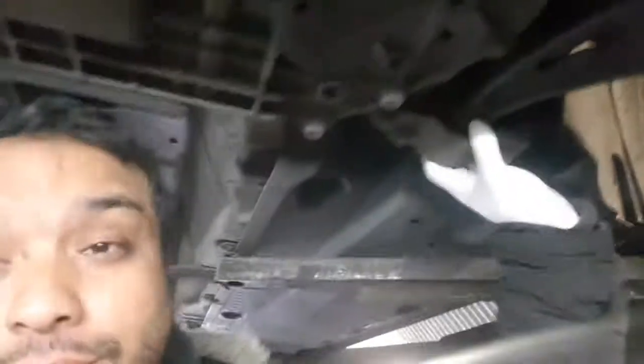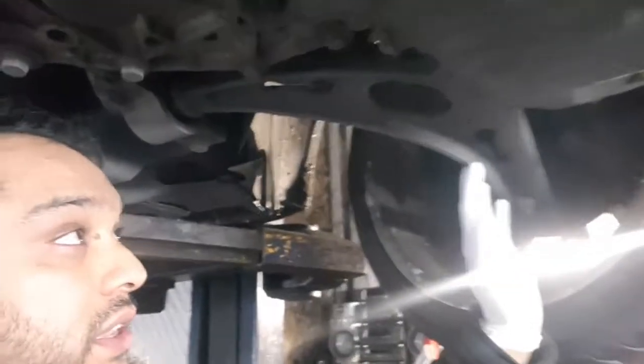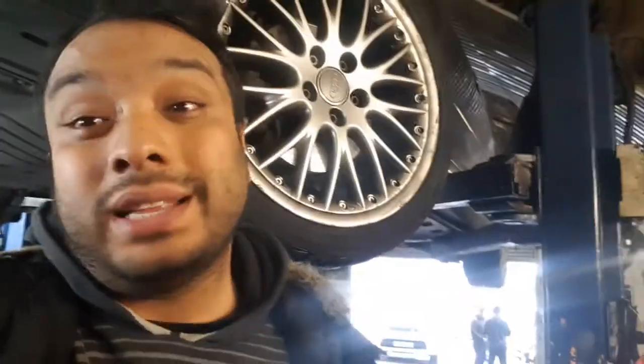So what we're doing is I'm going to change the front wishbone rear bushes — this one here. The thing is, you don't need to go ahead and change the complete wishbone, the complete suspension arm. You don't need to change that, because if you do, sometimes you need to get the wheel aligned — the tracking gets misaligned. Best thing to do is just change the bushes. Dead easy job. I would recommend that actually, then you know everything is original, the car is original, the wishbone is original.